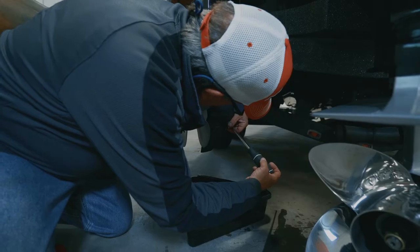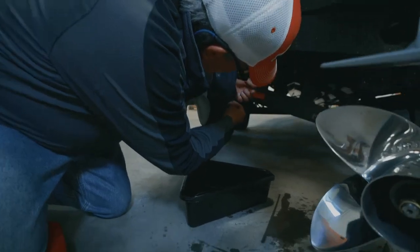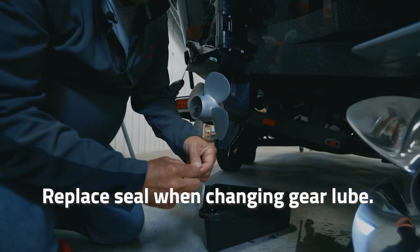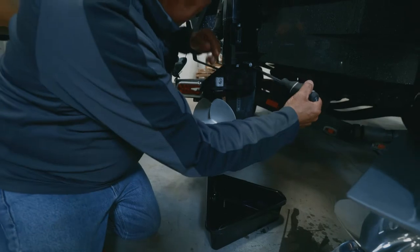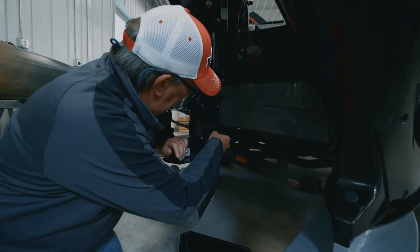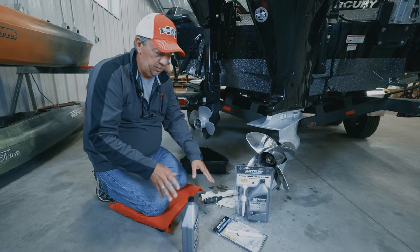Take that off slowly to release it so you can get to it with your fingers. Slowly take that off and you'll see the oil starting to drip out. There's a seal here you want to make sure is in good condition — I always set that off to the side next to the screwdriver. Now the oil level screw you want to remove from the top, because that breaks the vacuum. Remove that, and you can see how the oil starts to drain at a fast rate.